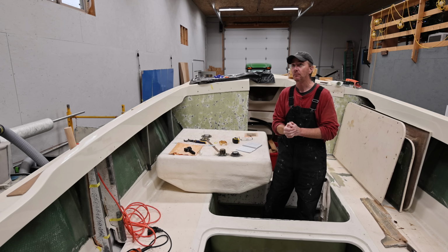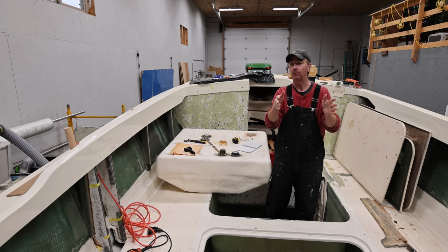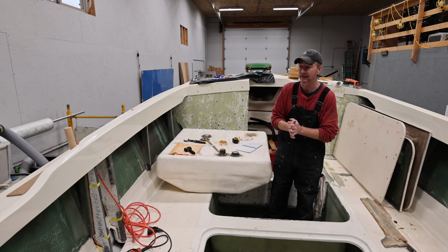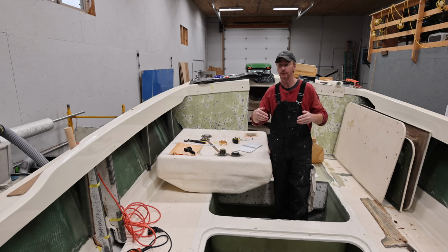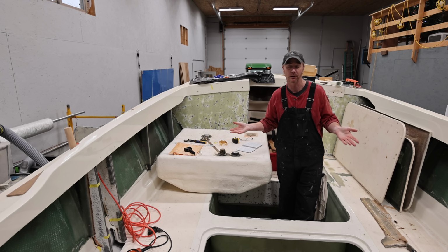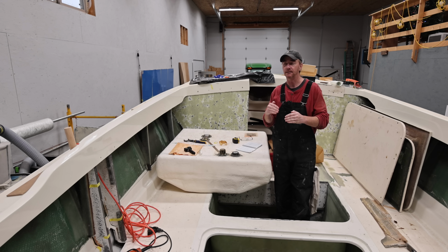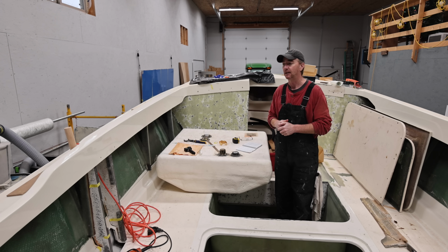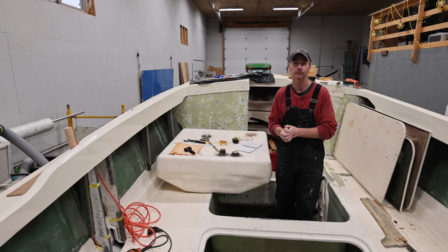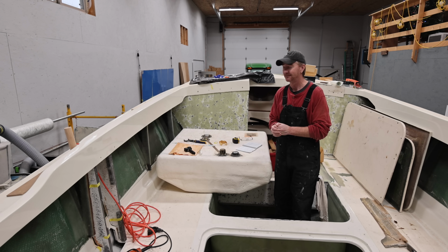The one caveat there is that the 1,000 pounds from the outboards is going to be hanging almost 3 feet further back off the transom versus the original inboards. They were pretty much centered right in the beamiest part of the boat, giving the most displacement. So I'm going to be really curious to see how that weight transfer actually translates, but I won't be able to take a look at that until springtime. We still got 3 feet of snow outside.